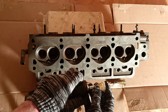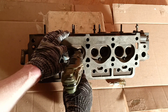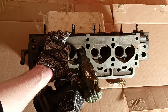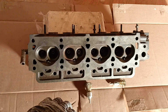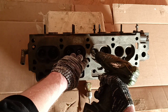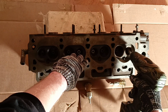Exhaust ports and intake ports have different diameters, so we can change our brushes to different diameters as needed. We need low-speed drill operation and not hard pressing of the brush. It really depends how hard we push the drill and brush inside — we're not scratching the ports; this is cast iron.